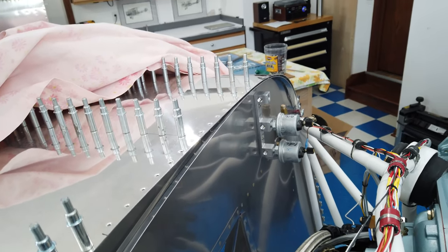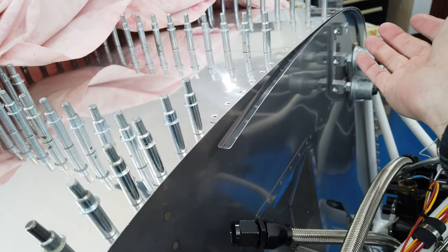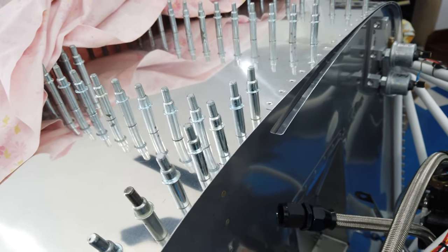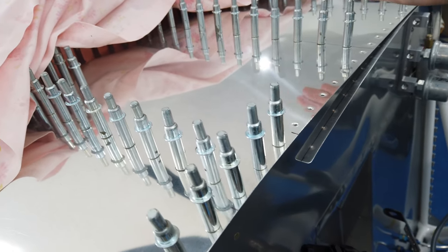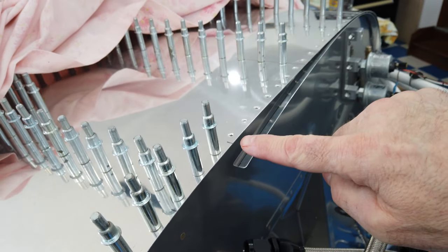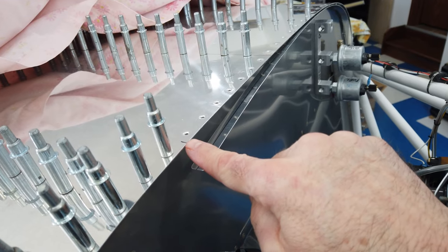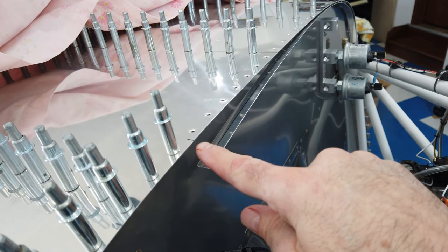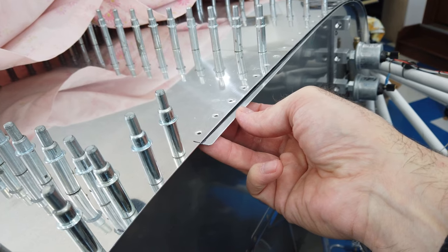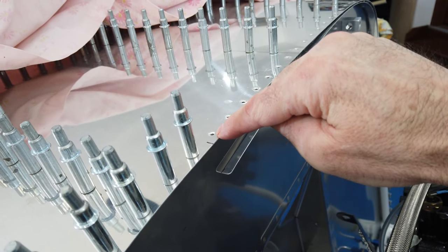Now I'm on the right-hand side of the airplane at the top firewall. Here's the shim, and this gives a better view of the 6.5-inch centerline measurement. Here is the centerline of the airplane, and from there the instructions say to come over roughly 6.5 inches - that's where this length of hinge stops. I went 6.5 inches plus about an eighth of an inch, marked a line, and the shim comes up to that line.